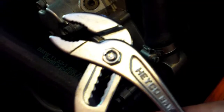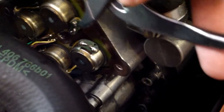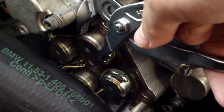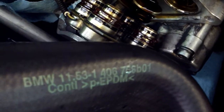Your next step is to pull these out. What you want to do is take a plier-type tool — I got this out of the car tool kit. Open it up until it's big enough, grab each individual solenoid like this, and start wiggling them out. Don't pry too hard; do each one individually, one at a time, and go slow so you don't pull the solenoid out without the board — that green stuff right there. There you go — all four solenoids out.